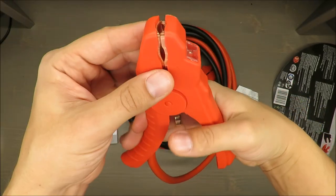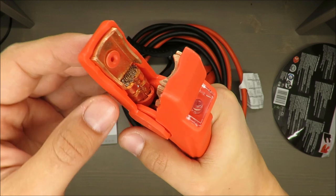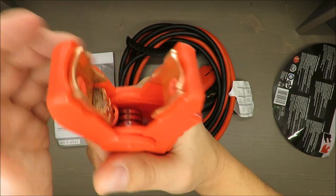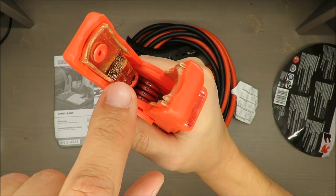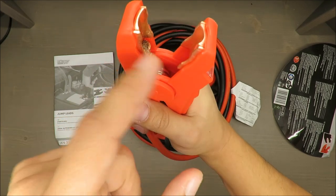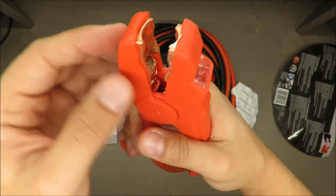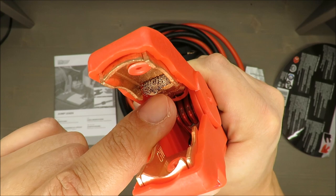What is lacking is the connection — let's call it the crocodile clamp — between the bottom and upper side. When you connect two car batteries, current will flow through, but this metal part here doesn't contribute to that. In professional cables, the connection is supported between the cable and the upper part of the crocodile clamp.